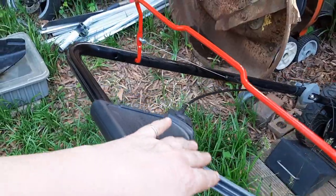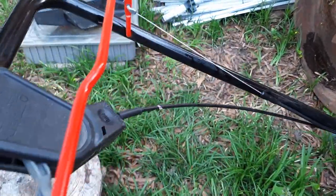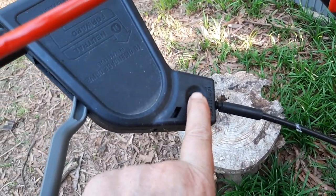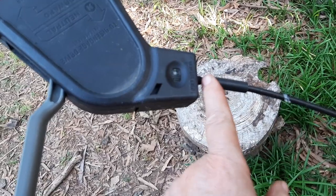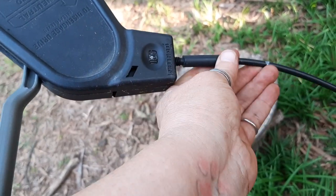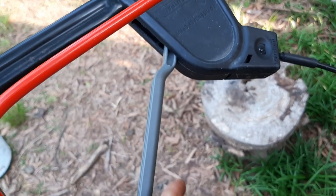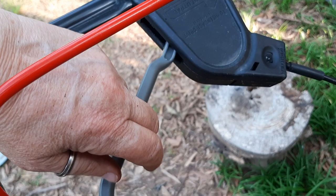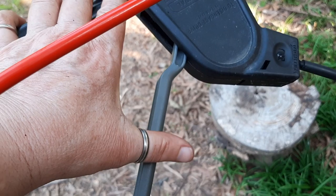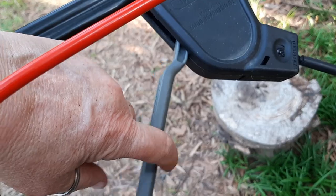She did complain that the front wheel drive really wasn't very responsive, and it's a really easy fix. There's a little switch on here that says tighten, and you push it in that direction. What that actually does is increases the outer jacket length, which at the same time shortens the inner cable so there's more tension. There's about one quarter of the travel until you can feel it actually engage in the cable. It was completely loose before.